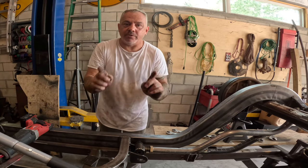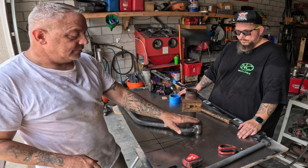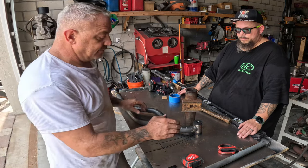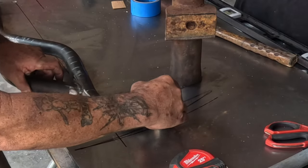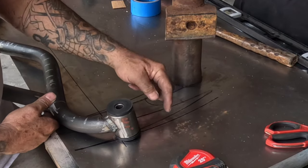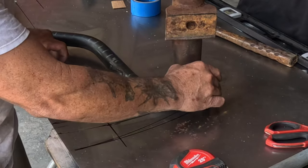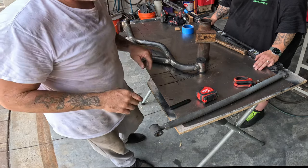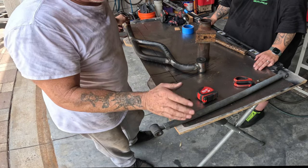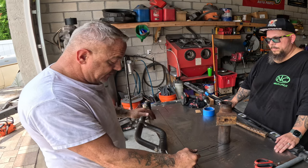Let's go to the chalkboard and show you what we've got. Basically, this is how the link bar is set up in the chassis right now. When I raise the suspension and follow this line, you can see the arc is pushing the rear — because this is attached to it — towards the back of the car. And that's no good. The bar technically is parallel with the ground, but it's nowhere near parallel to the ground in the correct sense. This would be parallel to the ground. So this contraption all it did was confuse me.